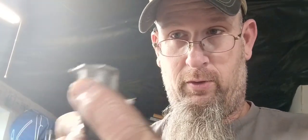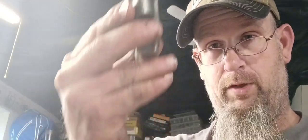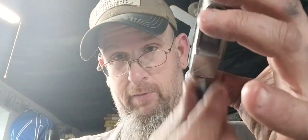These caps on a Ford motor are numbered, and the numbers need to match on the same sides, because if you put this cap on backwards, guys, you're surely going to spin a rod bearing or have other problems. So I'm going to leave this motor turned like it is. I'm going to go down below and just run my rod bolt nuts, these little guys, up there with a ratchet, and just hand snug them for now until I get all 6 pistons in. Then we'll roll it over, and we'll torque them to spec. So be back here in just a moment.